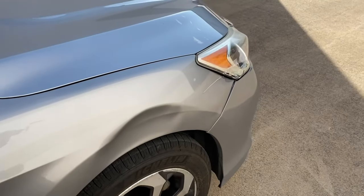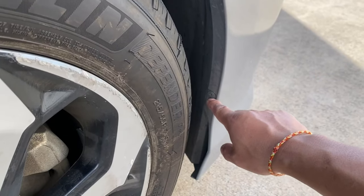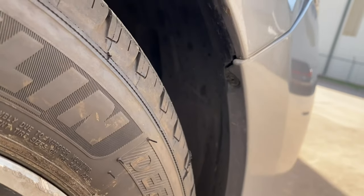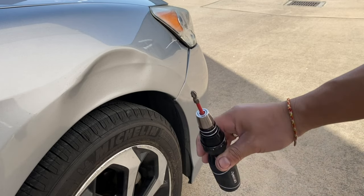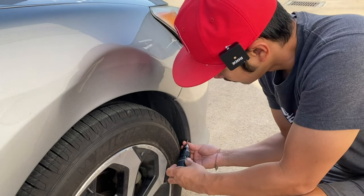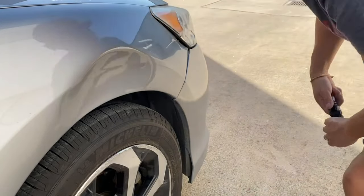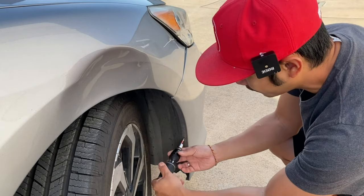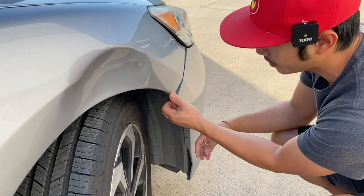To remove this fender, we're going to start off right here on the bumper itself. We're going to take off this screw right here — it's going to be a Phillips. And then again, there's going to be another one right up here, also a Phillips screwdriver. You guys are going to need a Phillips like this one. Let's go ahead and unscrew this. If the wheel is in your way like mine is right now, go ahead and turn it so we've got a better angle. Go ahead and take those screws off and we should be able to pull this back like this.